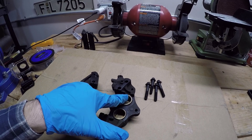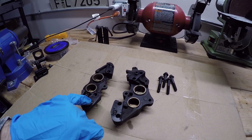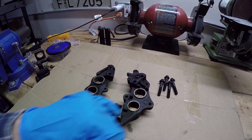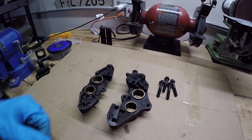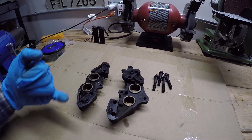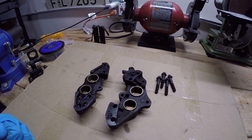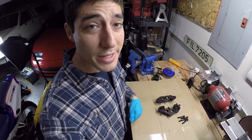So what's going on is as I push the brake lever, it's only activating these top two brake pistons, and these bottom brake pistons aren't being pushed out. Therefore, the pad is not contacting the rotor flush — it's only contacting it at the top. Hopefully I can unclog these bottom bridge ports. We're going to take out the pistons, clear out these ports, and flush the whole caliper so brake fluid can run freely top to bottom, operating both pistons equally.